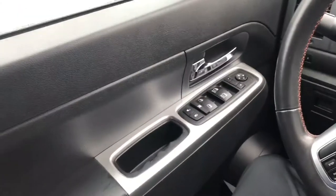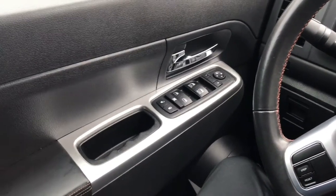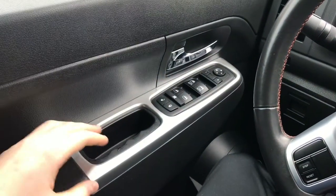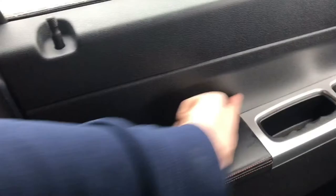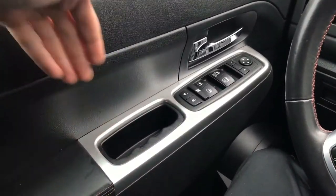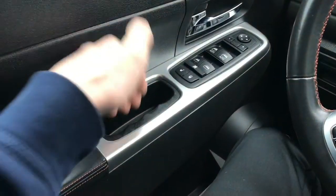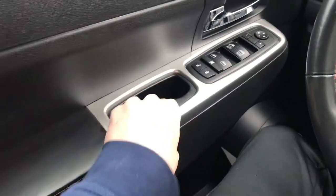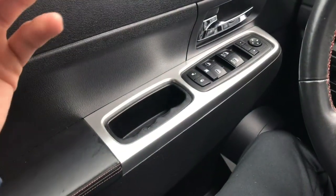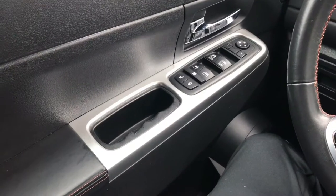I explained the door dampening in my Lost Jeeps article, which I'll have linked in the description — it's extremely comprehensive and explains how I dampened some of the door panels. I put some foam I had laying around the house on the inside, on any big flat pieces like down here. There are also clips on the back side of this panel that clip into these little slots and hold the door from pulling out. I put some electrical tape around those clips to keep any plastic-on-plastic connections free, which could cause rattles.